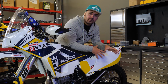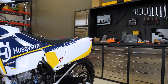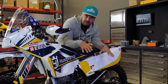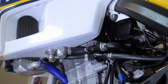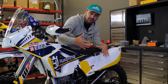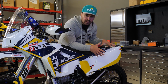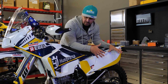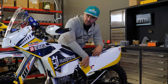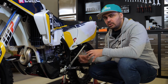Looking at the second fuel tank we placed on this bike, we have a 5-liter fuel tank painted in white, and this is a plug-and-play tank, so it connects to the front with no extra fuel pump and no extra vacuum pump. It's just a hose that connects direct here to the front tank. So easy to remove, especially if we are racing and maybe we don't need all the autonomy, as the combination of the two tanks gets you about 300 kilometers autonomy. We can still access the air filter by removing the plastic, as we slightly cut the side panel in order to fit the tank.